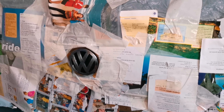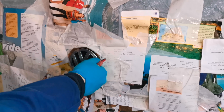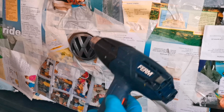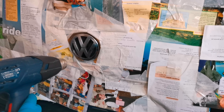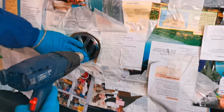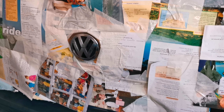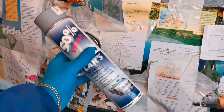And around it. After that you can use compressed air. After that, this is optional — if you have a heat gun like I have, you can also heat the emblem, because the paint will stick better if the emblem is hot or warm. Take it with your hand — you don't want it to be too hot. Now it's perfect. And make sure you put all the paint and primer into a bottle of hot water, because the paint will work properly if it's heated.